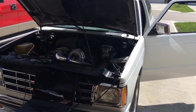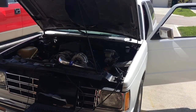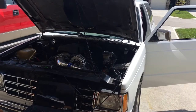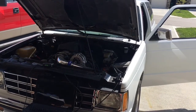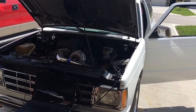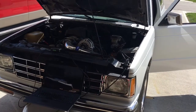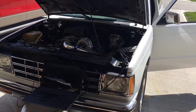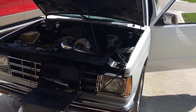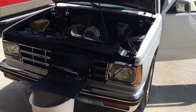When I went back in this time, I found out I had set the rev limiter at 6,500, abuse mode top speed at like 256 miles an hour or whatever the maximum allowable figure is. The reason it was cutting out at 6,000 RPMs is because it had a fuel cutoff setting. The fuel cutoff is what I was hitting at 6,000 RPM — it had a cutoff of 6,000 and a resume RPM of 5,950. So I fixed that.